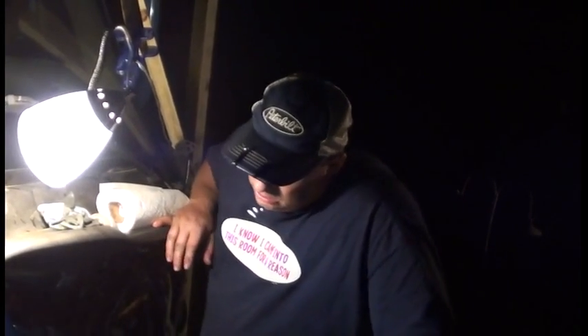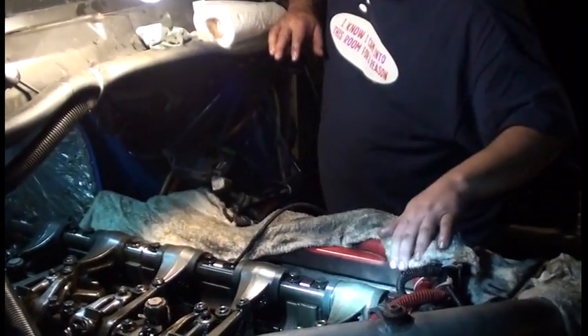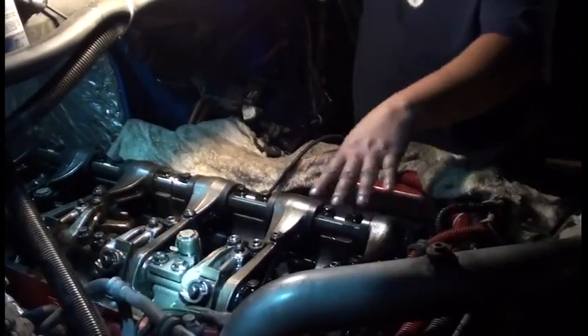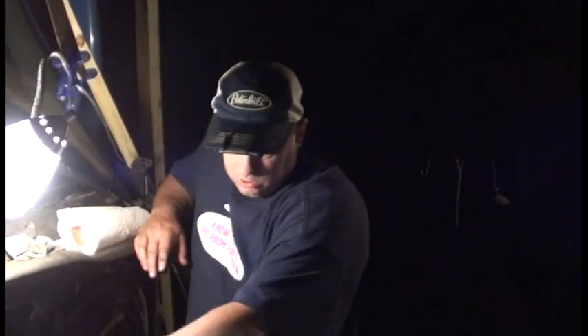A lot of guys will take clean engine oil and squirt it on all the parts in here before they crank it up. Double-check things, make sure it looks good. After you run the overhead, take a little bit of WD-40 or penetrating oil and just wash all these rollers a little bit - just to get the dirt and stuff off of them, dust and things. Also the very edge where the gasket goes for the cover - wet it down a little bit with some WD-40, wipe it off really well so it'll seal good and you don't get trash and dirt under the gasket seal.